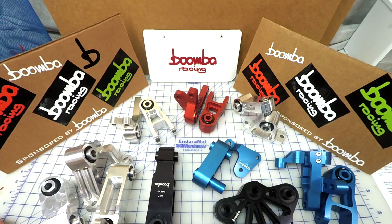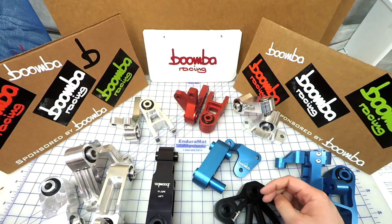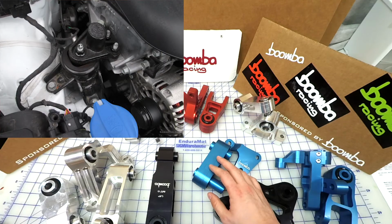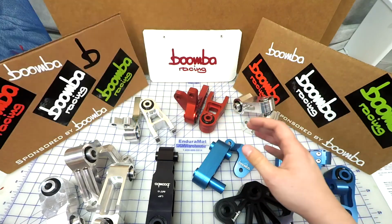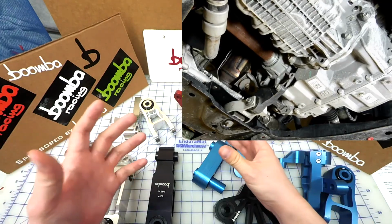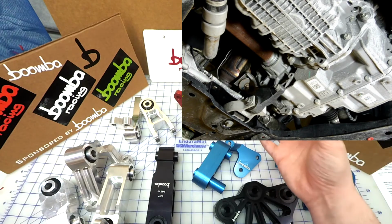An engine or motor mount is the component responsible for securing the engine of a vehicle to the chassis. In some cases, this even refers to the engine and transmission combo, depending on how things mount. Some mounts are much more critical to securing the entire engine assembly to the subframe, whereas other mounts assist in just the back and forth movement or the swaying motion of that powertrain.